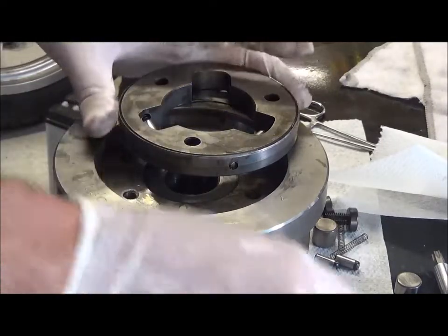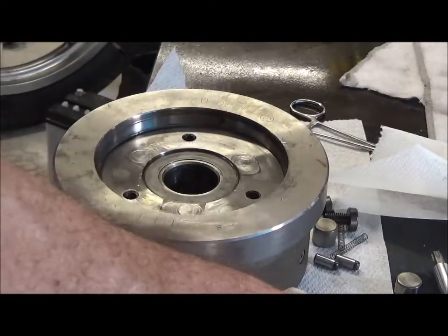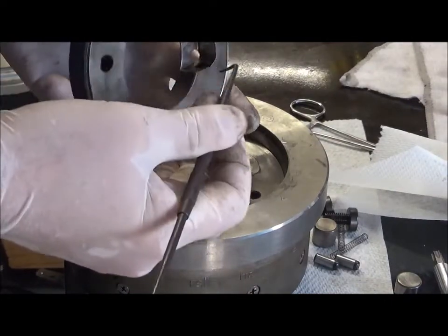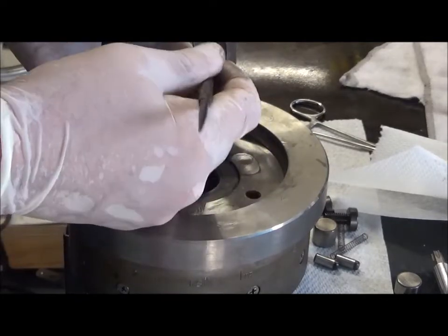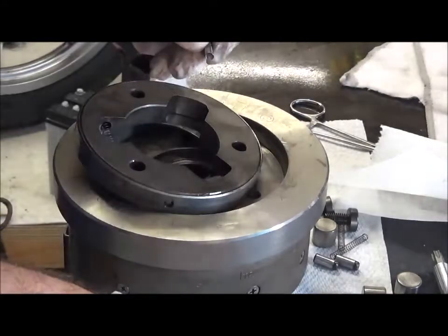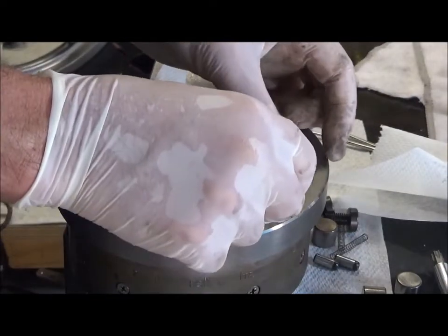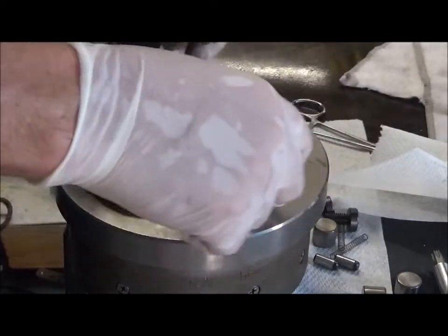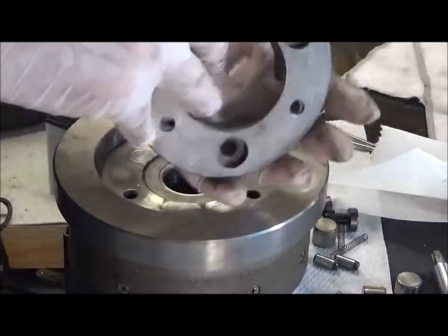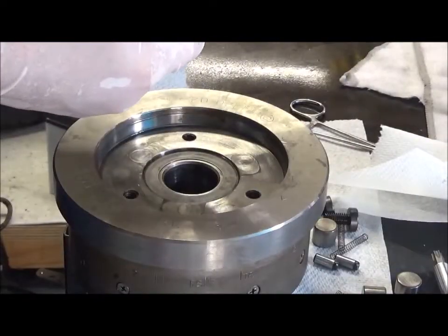There's something stuck in there. I have to investigate that. Could be the old spring. Terribly deformed. Yep, broken. Was broken. You can see the difference in size. And I can't see it in there. I'll just take all the other springs out. That's possibly why it was having a bit of trouble engaging as well.